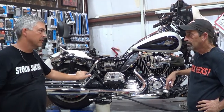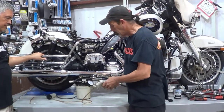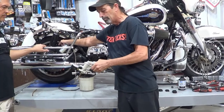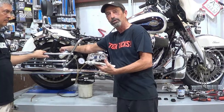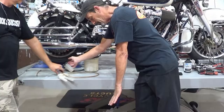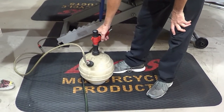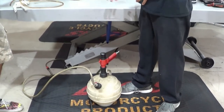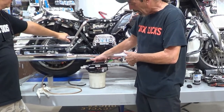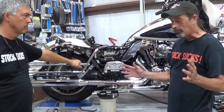So we're gonna teach you some secrets. Tracy's gonna lead this one. We have three different styles of bleeders here. This is obviously the cheaper one that you can plug into your brake caliper and start pumping until it builds pressure and it'll slowly suck your fluid through. Or you can go with the most expensive one — this is called an Orb from Snap-on. It works very well, though I feel it's kind of cumbersome to use. So I have this medium one here that I like to use — it's a Vacula, for bleeding brakes. Any one of them works just fine.